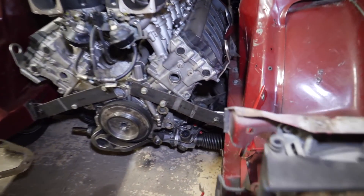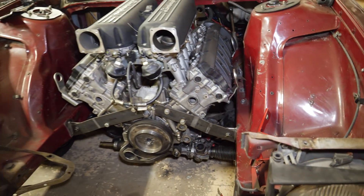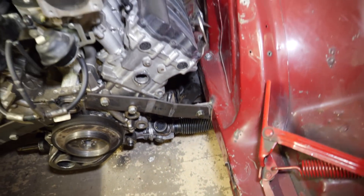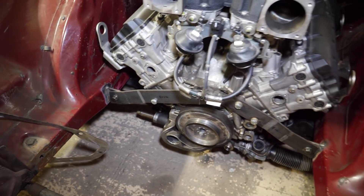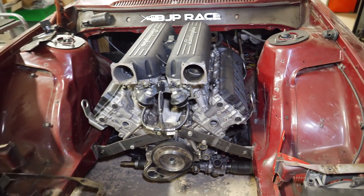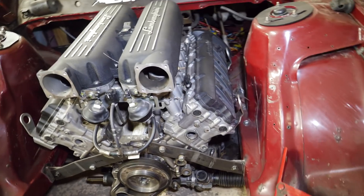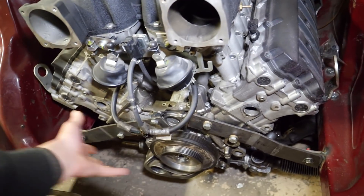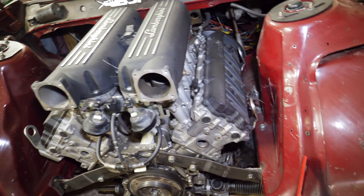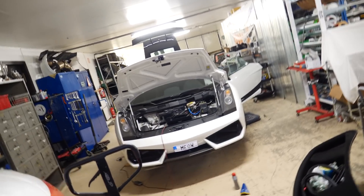About the engine mounts — I'm not sure what's going to fit on the sides here with the headers, steering, oil pump, and hoses. So I waited on those mounts and did some mounts in the front of the engine instead, welded directly into the chassis — just temporary so I can have the engine in the correct position and build headers around it. Then we'll see what kind of engine mounts will fit. Maybe I can do rubber mounts up front where there's some space. Thanks for watching — next video maybe with my Lamborghini.